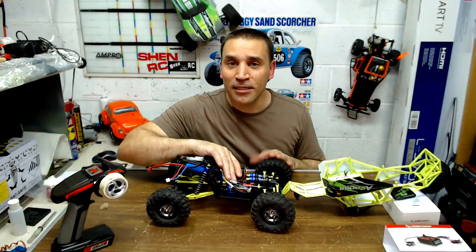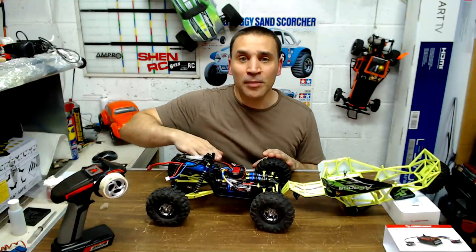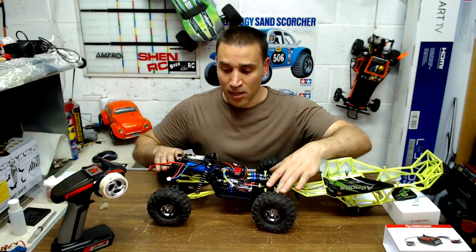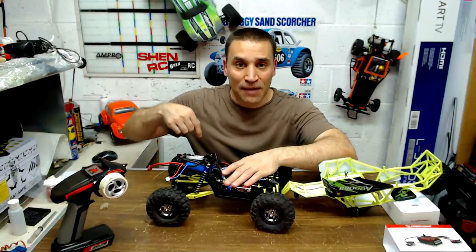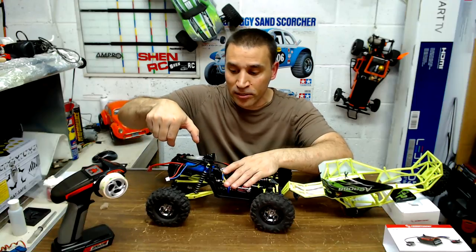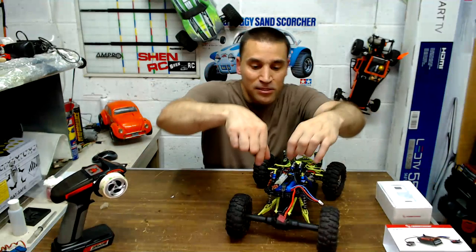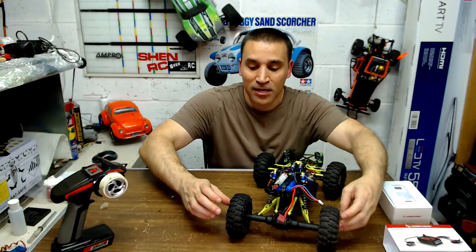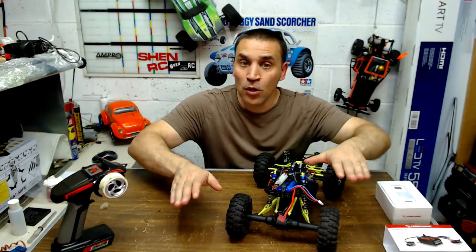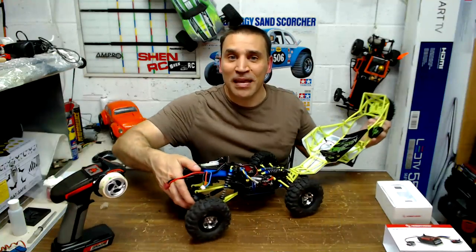I'm surprised no one did this yet, because I did it with motors back in like 1980-something. I made an aluminum chassis pan car with the steering with the servo like a normal pan car. But on the back of the pan car, you know how they have an axle with the gear and you put a motor? I didn't have that. I had two 540 motors screwed down onto the chassis sideways, and I had the foam tires and wheels directly bolted onto the motor shaft. No gears, two separate motors, one for each wheel. It was so smooth and it didn't make no noise.